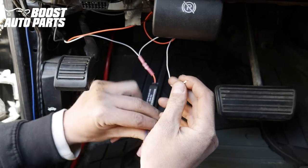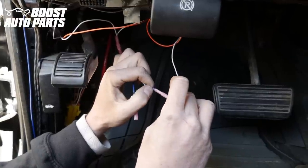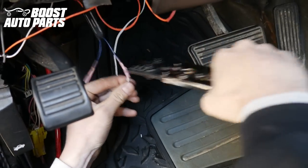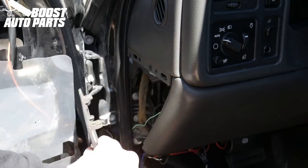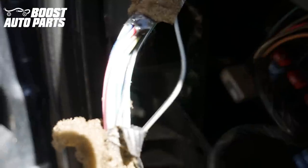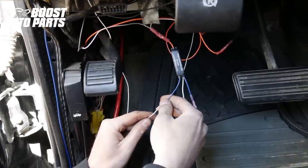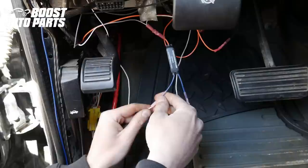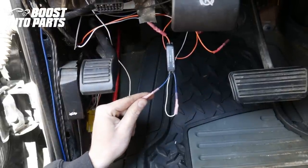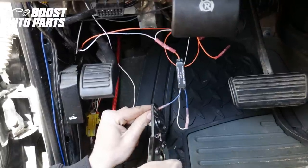Originally we ran the white wire under the hood and tapped into the trailer backup — we're going to use that as one of the inputs. We're going to put that into one of the blues and go ahead and crimp it down. Go ahead and remove this trim piece. You're going to untape this wire loom a little bit and look for the gray with black stripe wire. You can see we have it pulled off to the side — go ahead and splice a wire there, run that down into your lower kick panel, and tap that onto the other input. We've gone ahead and run that dome wire down — put that under the other input, which is the blue wire, and crimp that down. We used a spare piece of wire, tapped to the dome wire which is the gray with black, and crimped that down.